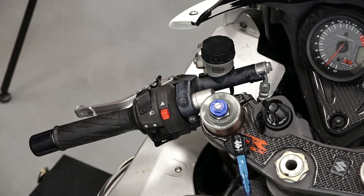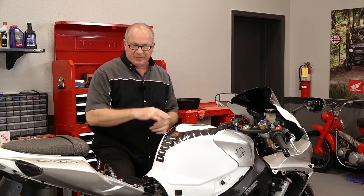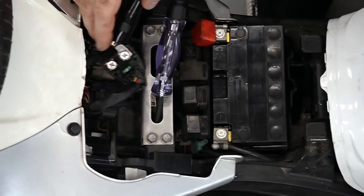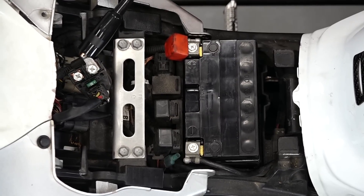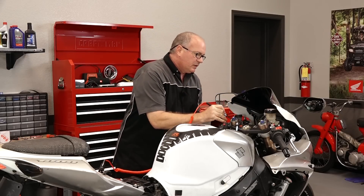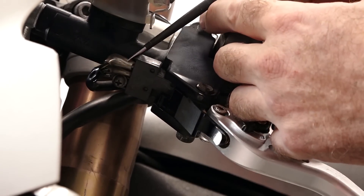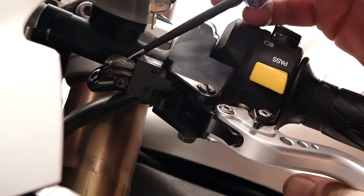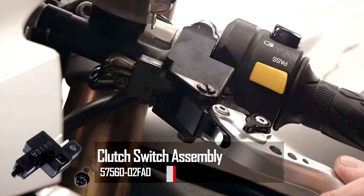There's one final circuit that I want to show you and it's really easy to test. If all that's working out and she's still not starting up, need to look at your clutch switch. It actually operates by completing a circuit that's just grounded. So what you want to do is take your test light and connect the clip side of it to a positive — I'm running up to the starter solenoid. Turned on and then we go to the top connection — it's just a pair of wires that head up there. The top one is the one we're after, and what'll happen is this will light up if it completes the ground. Boom, there it is. So that tells me that the internal switch for the clutch is actually working.